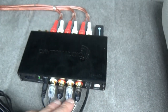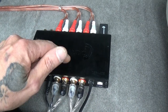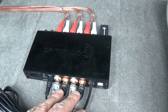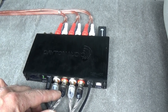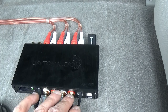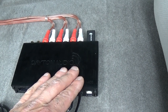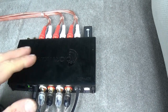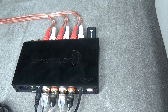We have the inputs from the head deck ran in — we have our lows and our highs here. It doesn't really matter how this is; it's just a signal and it actually processes inside here whether it's high or low. These are set to full range coming in from the head deck. The one is set for subwoofer so I can turn it off on the head deck. The signal goes in and comes out these two here, going into the amp for the highs — set up with low and high-pass filters so it only gets certain frequencies for mids and highs. The DSP is listening to these ports to output to the blue amp that's under the seats.